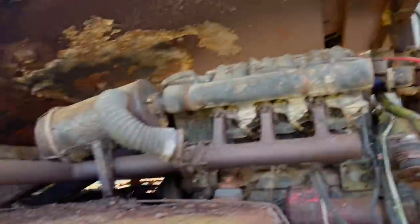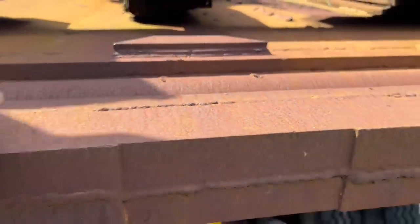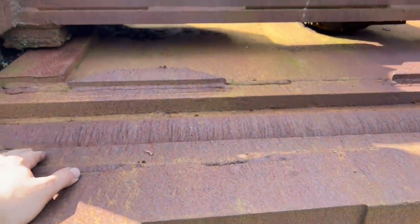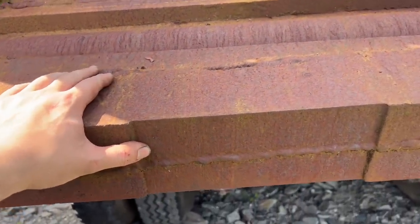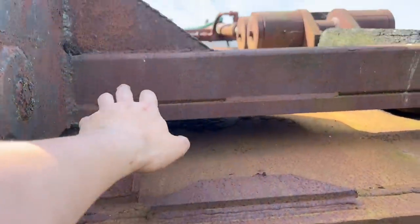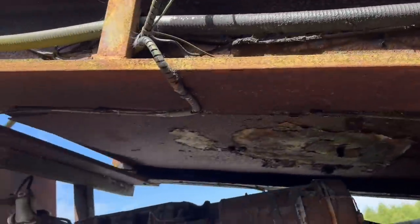Got to walk around the other side and see the dent better. Here's the 15-tonne slab again. This whole thing was EN50 and then hard-faced. With these castellations, it breaks up the concrete when it's dropped. It lifts up on that ram — this whole thing slides up inside the casing and then drops down under gravity. It's just massive.